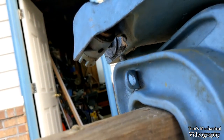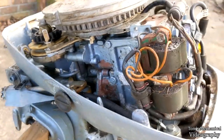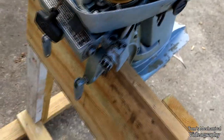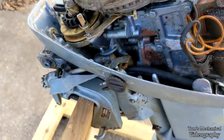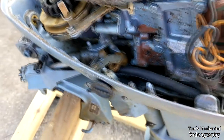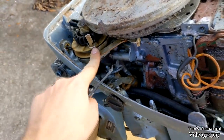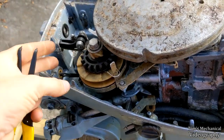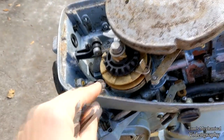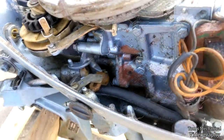The next step is to get that snap ring off so you can pull this whole bushing out. That should allow you to pull this whole shaft and everything right on out. Then you'll need to disassemble all of this linkage, which requires taking this screw off, pulling this out, then pulling this cotter pin out, lifting it up, off, and over — it wants to fight a bit. You also need to pull the recoil starter, which is just this big bolt up here, but be careful not to let it unwind. Zip-tie it together so it doesn't fall apart. Then take these two bolts off down there, which will let you pull this arm right up out of here.